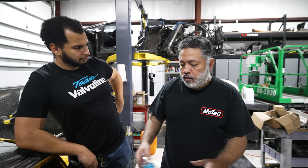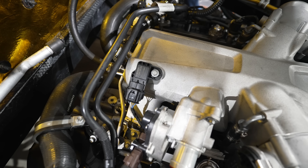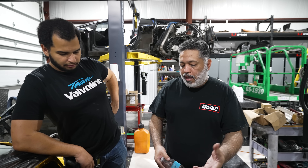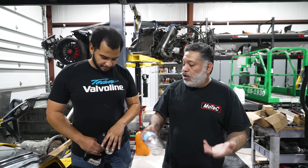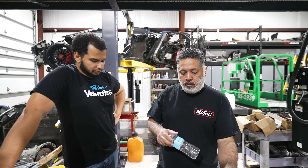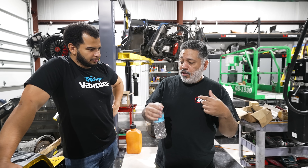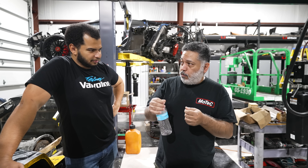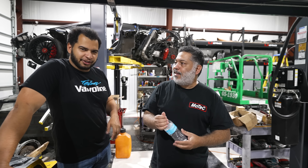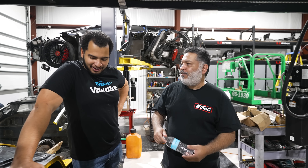There's also a MAP sensor that you find in a bunch of different cars. After doing this for so long, you start to recognize components. The one thing I couldn't figure out was the crank position sensor pinout. I knew which wire was power, but I couldn't figure out signal and ground. So I left the wires so I could swap them — cranked it the first time, didn't get the signal, swapped it around, got the signal. You wait for the smoke to come out, or in this case, 5,000 RPM.